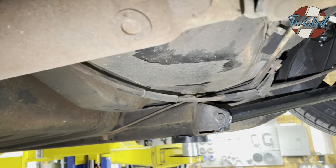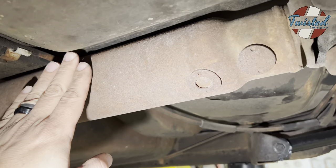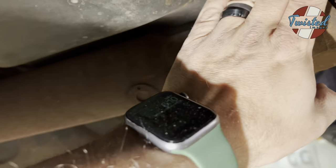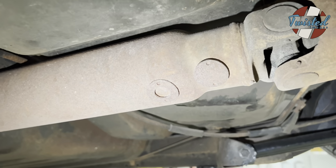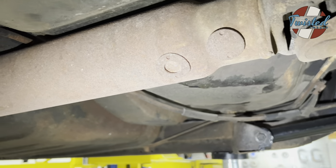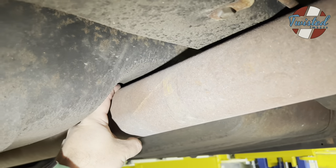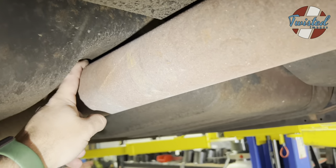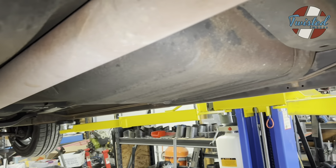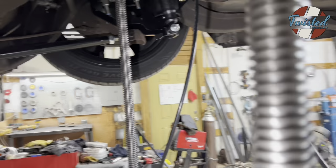So the big question mark is, we know we're going to cut here. This is all under seat area. So we're just going to make a straight cut, zip, and on the other side and get that clearance in. And then see if we're all the way up in the notch at that point without getting into here. Looks like right now there's probably about 3/8 of an inch of clearance. And the closer we get to the transmission, the less it moves as it drops. So we're really, really close already. It's already up in the notch a little bit.